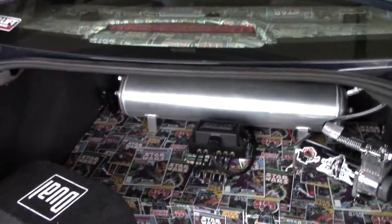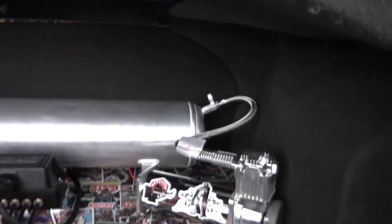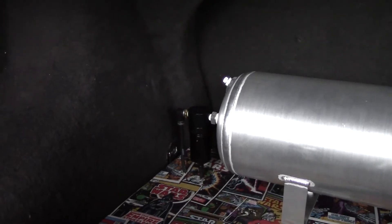Let's go down into the trunk and take a look at where I have my water trap. Here's my trunk setup. In the middle you have the manifold, and the compressor that fills on one side of the tank. On the other side of the tank — my exit — where all the air comes out and goes into the manifold and the rest of the system, right there on the end, that little black tube-looking thing is the water trap. It came with the kit and it's maintenance-free and in-line. As the air comes out of the tank, it goes through the water trap, which traps any water in there, and then the air exits the far left and goes down the line into the manifold.